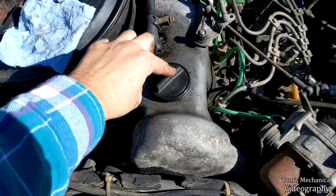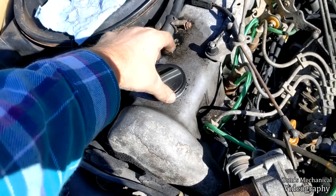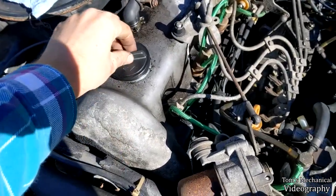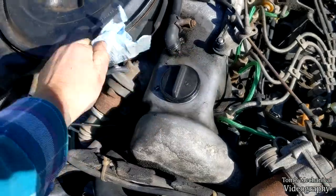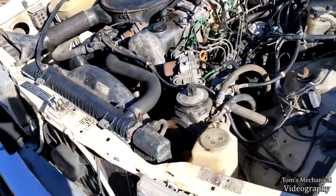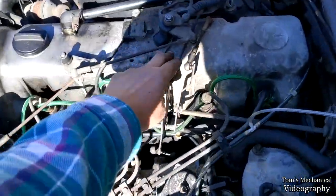I mean, that could be better, but it could be a lot worse. I think it's more so the engine. Ooh, that's hot. And there's the blow-by. Well, we'll just say she's kind of mild out. I don't think she's as in good a condition as I originally thought. You know, not for 170 on the block. I mean, she's probably in average condition. All right, well, it doesn't appear like we're leaking diesel anywhere, so that's a good sign. Let's see if she'll sing a little bit.